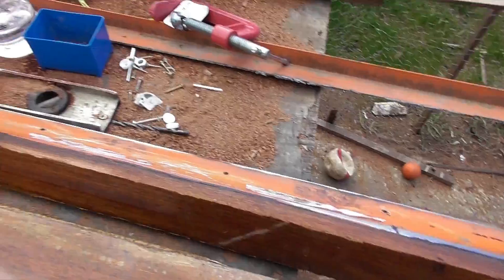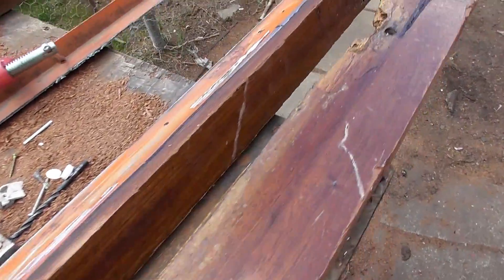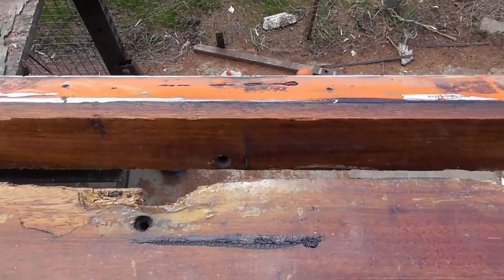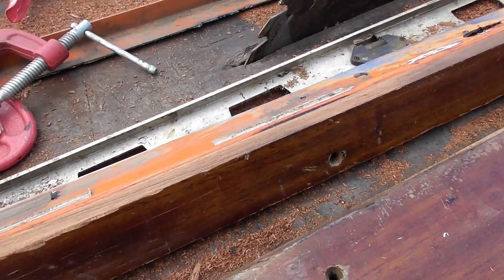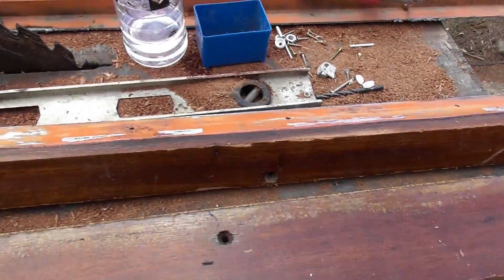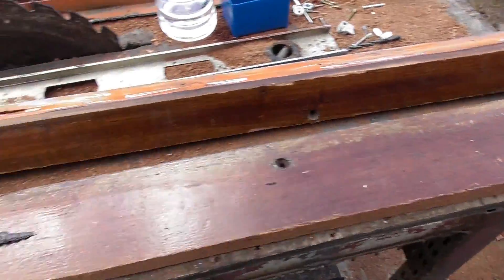Holes are drilled. We'll get the sealant, go along that wood line and that metal line, lower it down onto the roof, mark where the holes need to be, drill, and while I'm up there I'll put the rubber seal in place as well. I'm not sure yet whether I'll go with two seals — it hasn't worked well on the other side because the seals are wedging; there's barely any tolerance on the roof of the other one. I've found out what the issue is, I just don't know if I can deal with it. It's proving troublesome.